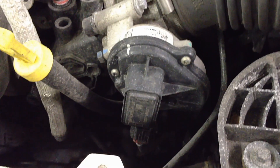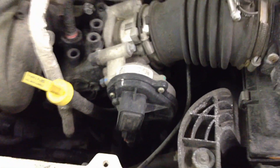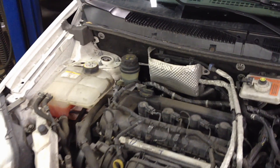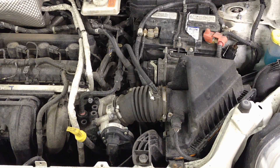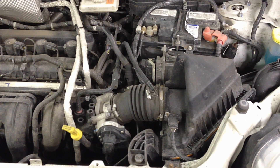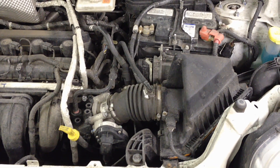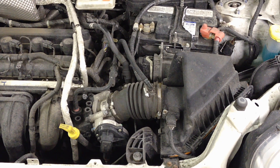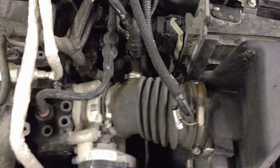This is a really common issue and we've been monitoring it. We're going to go ahead and change it out today. Since the Transit Connect is basically a big Focus with a boxy back, replacing the throttle body here will cover both the Focus and Transit Connect procedure.